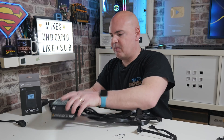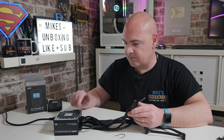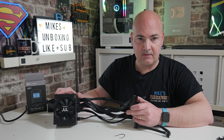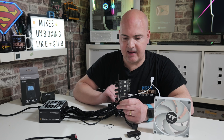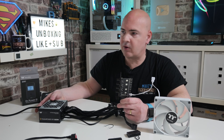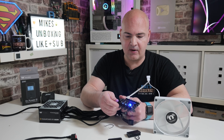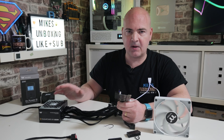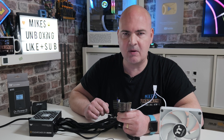So next we're going to try the power supply. Grab the power supply, turn it to the off position to start, and plug in your mains cable. Now if we turn on the power supply — it clicked, but as you can possibly see the fan isn't moving. We did definitely hear a click, so there are some signs of life. What we're going to want to do is plug in something to one of the SATA or Molex connections just to validate there is actually power coming through. So now we've got our Molex-powered fan controller and our fan connected, set it about halfway on the fan speed, turn on the power supply — and there we go, the fan is spinning. We've also got an LED on here to verify there is power going through.